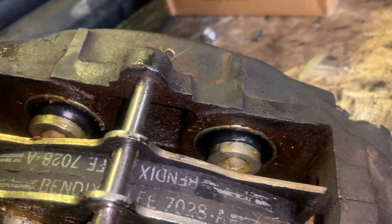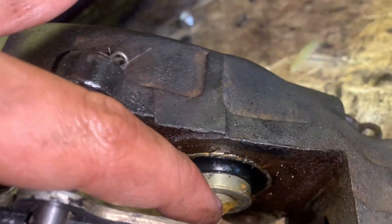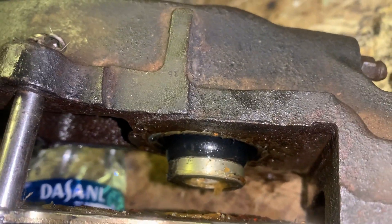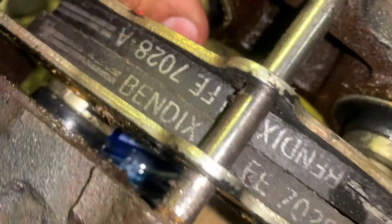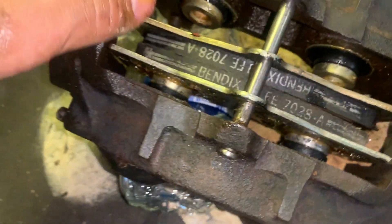Now that we've got the caliper up on the bench, I'm gonna squeeze these pistons until I see brake fluid come out, and I think it's this cylinder right here. Let's check — yes, that cylinder did come out. There we go, you see the dripping right there? Bingo! Wow, that's a steady drip. It looks like it's getting past the seal right there. I didn't think I was gonna find it that fast. Let's check to see if the other ones are leaking.